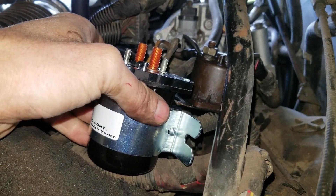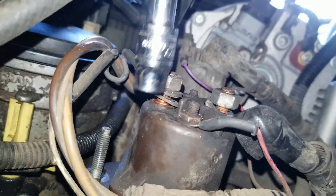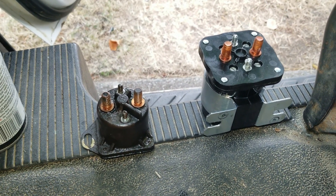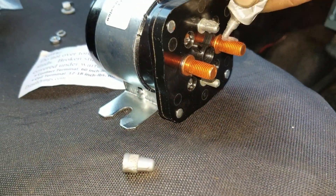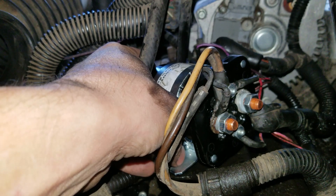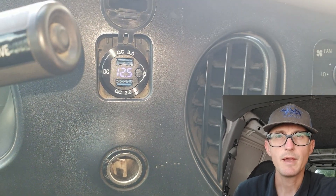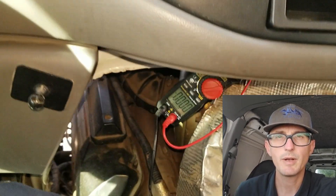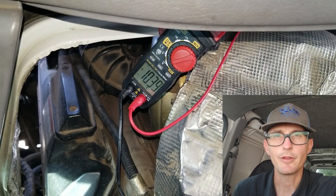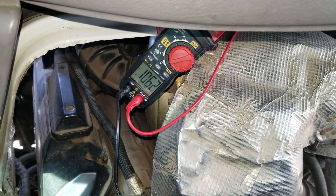Here's the new one — it is that much bigger. Here's my old glow plug relay and the new Stancor White Rogers relay. It's a much heavier relay. I'm going to put a little dielectric on each of these terminals. Just got to get these wired up and we'll be all done. And there we have it — all wired up, ready to go. I'm not seeing a huge difference in the amount of power lost over this relay versus the old one, but I think that's mostly accounted for by my onboard meter not being super accurate. My old relay was working okay — I just wanted to do this before the van left me stranded somewhere in the cold. I didn't measure amps to the glow plugs, but it does seem like this is pulling a lot more juice off the batteries than the old relay was.